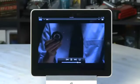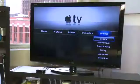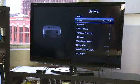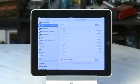With the iPad you can play movies, but if you want to transfer what you're watching on the iPad over to your big screen TV, you can actually use AirPlay. The first trick is to make sure that your iPad and the Apple TV are on the same network. Go to your Apple TV, check to see what the network is, then go to your iPad and make sure you're connected to the same network from the settings menu.